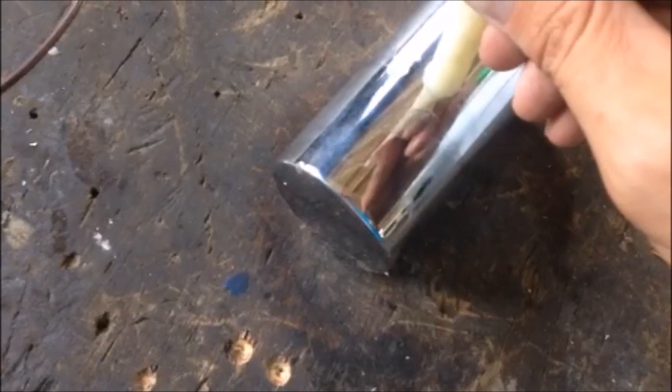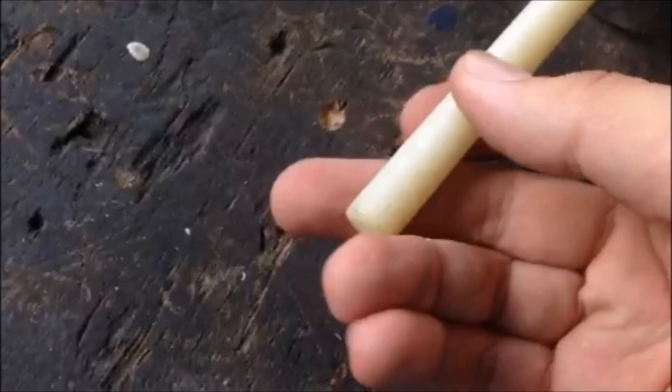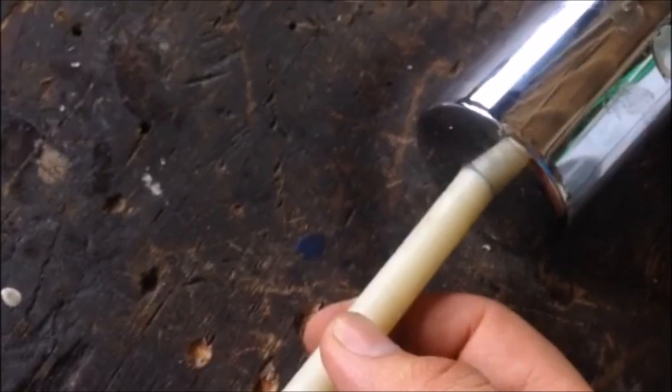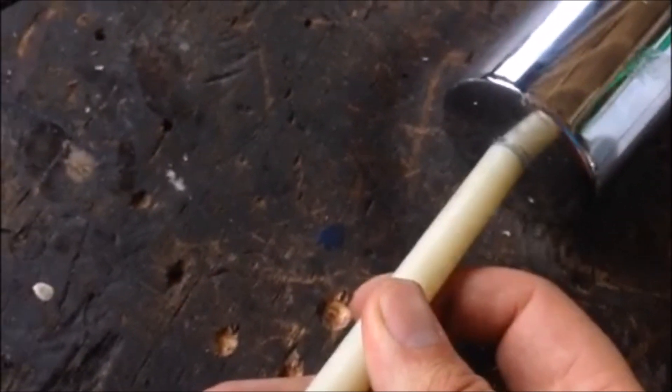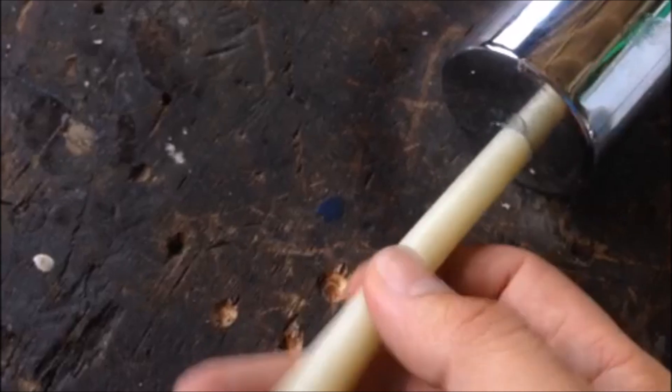When I went to lift up the coil, it burnt my hand. This is a hot glue stick right here — the coil is so hot right now, it's actually melting this hot glue stick. So even though there's a negative and positive on the top of this coil, it's very imperative that you do not hook it to direct DC 12-volt power. You need to be able to pulse the negative. When you hook it to direct power, it's pretty much a dead short and it gets extremely hot. You can see it melting this glue stick.